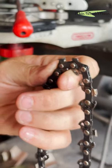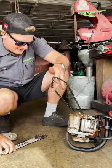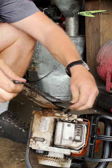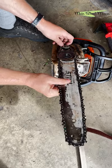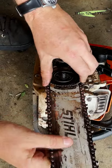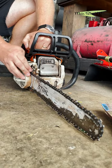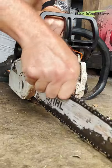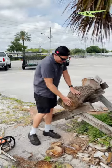Okay, let's reinstall this and we'll go cut some more. I'd like to put my chain on first. This raker has a little air but it's not tragic. There we go. Tightening it up — make sure you get your tension up as you're rocking forward. Let's go try it.